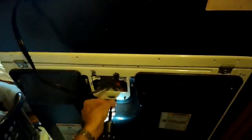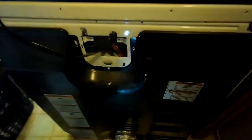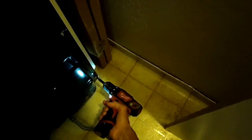And there's a little thermal fuse that's actually really inexpensive and easy to change. When these machines get overheated for some reason, usually due to a clogged vent tube, the thermal fuse will pop and no longer allow power to go to the heating system. And that's just to prevent fires. So it's a matter of finding out why the thermal fuse popped and then replacing it, which is really quick and easy. Usually it's a clogged vent tube. In this case, I think the vent tube was just not clogged but crimped.